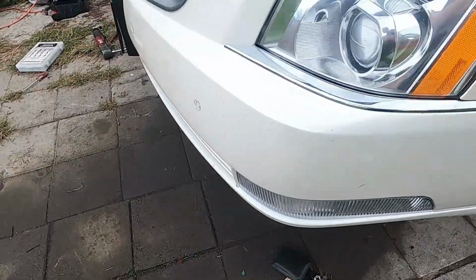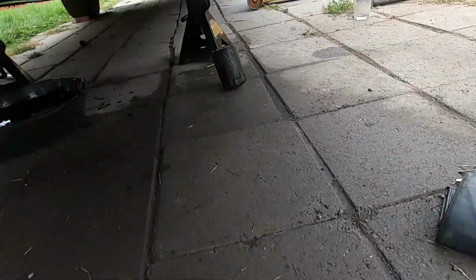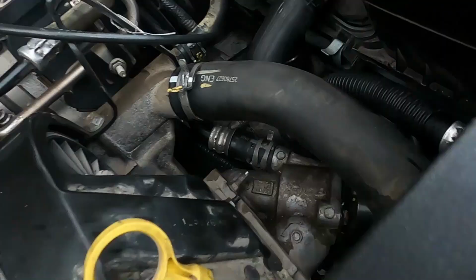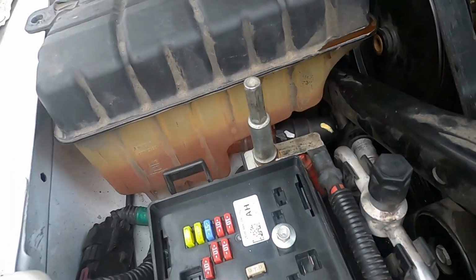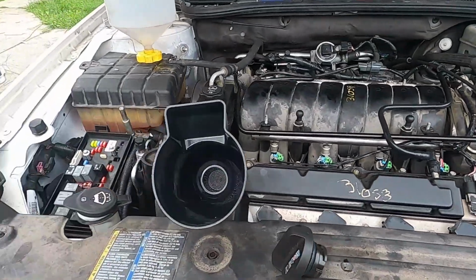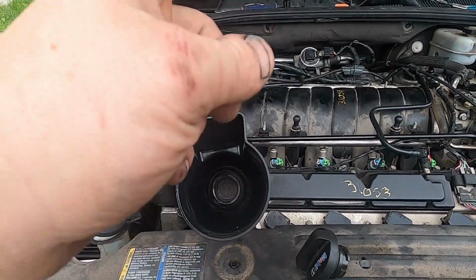We need tires to be put back on. I brought it down off the stand. The old oil filter's there. We got the new oil filter right up there, and the oil's been drained out. We snuck the radiator fluid in through this hose mostly, and we got some back up in here. It's straight, so we're gonna add some water to that, and we're gonna look up our fluid capacities for our oil and hook the battery up. It's under the back seat.